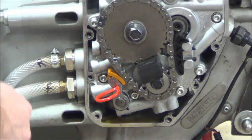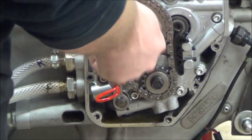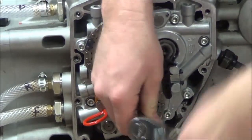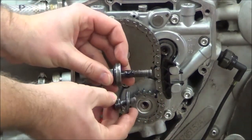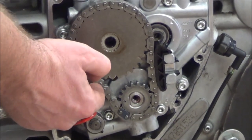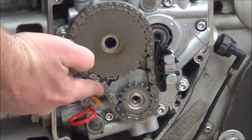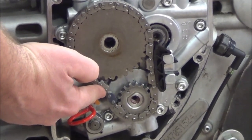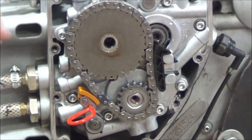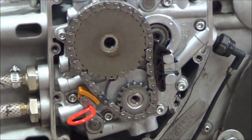All right, so we're making some progress. At this point I should be able to pull this back out and set the specialty tool to the side. Go ahead and line these up — I'm using that cast mark to aid me in what this looks like. Why am I touching this chain? Just to put a little tension on in case it could jump time. That's more of a concern on metric motors. This chain's very short so it's really not an issue here. We don't have to do this on disassembly — I'm just pointing out that those timing marks exist.